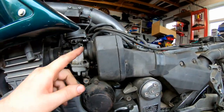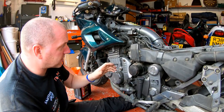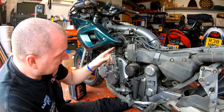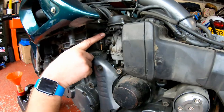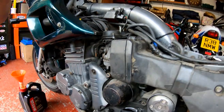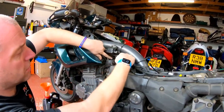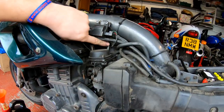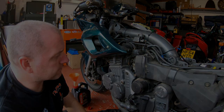Moving on to what we said we were going to do next — the air box and the carburetors. What we need to do is disconnect all the clamps front and rear: there's one on the air box, one there, and the same on the other two carbs. We've also got a couple of cables going to the choke — that's cable operated — and also the throttle cable comes down to this point here. So we need to disconnect all of that and then we should be able to remove them from the bike.